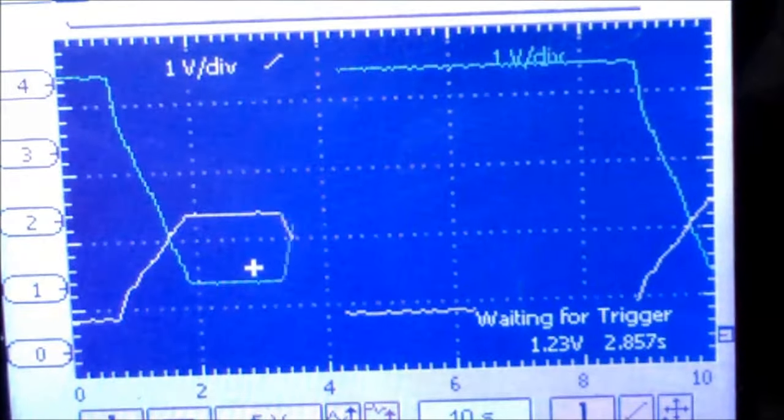To connect the Blue Voltage, as you can see on screen, identify which wires on the connector are the five-volt power and the sensor grounds — you have two of each. Then identify the signal wires. Connect the Blue Voltage to the five-volt reference and grounds, then connect channels one and two of your graphing multimeter or scope to the signal wires, and you're pretty much done.